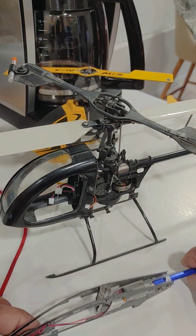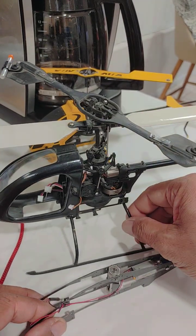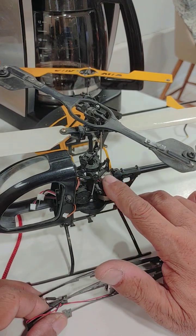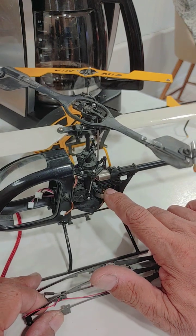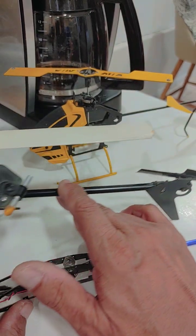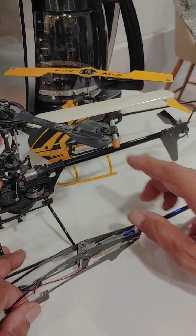In this video what I wanted to do is continue with some of these comparison details. As I said in one of my other videos, the Quark employs a very unique motor that's installed right above the main motor right here, that's driving a shaft to a 90-degree bevel gear system at the tail end, so that keeps it really lightweight at the tail end.